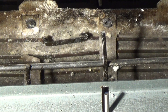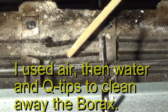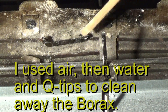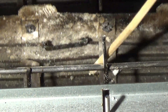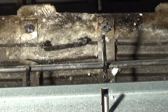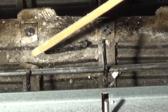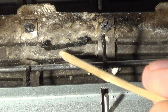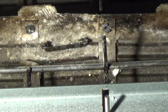So what we can see is that there's a patch — there's the old element — and this patch is kind of wrapped around and held mechanically, but it's not jiggling around at all, so it seems like it's attached much better than it was. We got some of that borax mixture under the tab that holds the elements down, and when it expanded it actually broke the tab. So a lesson learned: only get that stuff where expansion isn't going to create an issue.